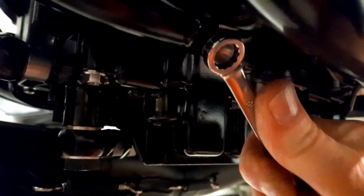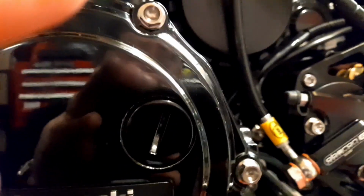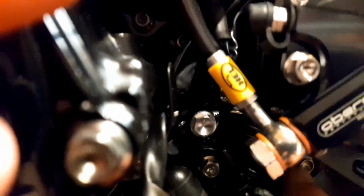So just before we fill it, just make sure that this is the drain screw here on the pipe that comes from the water pump. Just make sure that that's tight. Yeah, so it is. And this one here also, this is the bleed screw here. So we've got to make sure that that is tight for the moment. I just sort of nipped it up. So there it is. Okay. Now obviously I'll be loosening that to bleed it. So that's that. We're ready to rock.